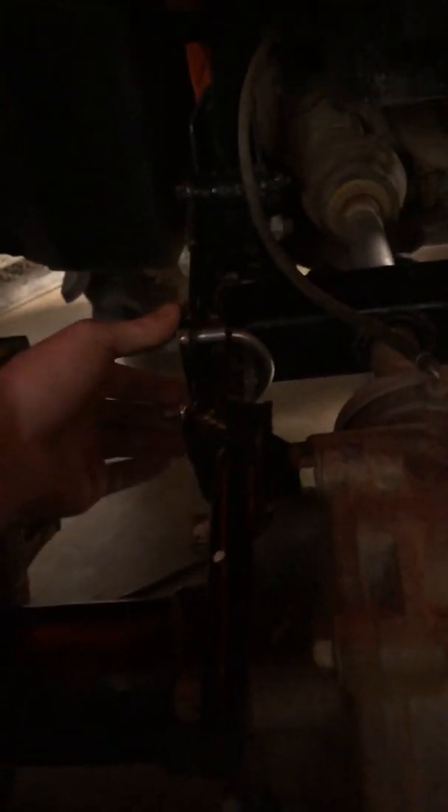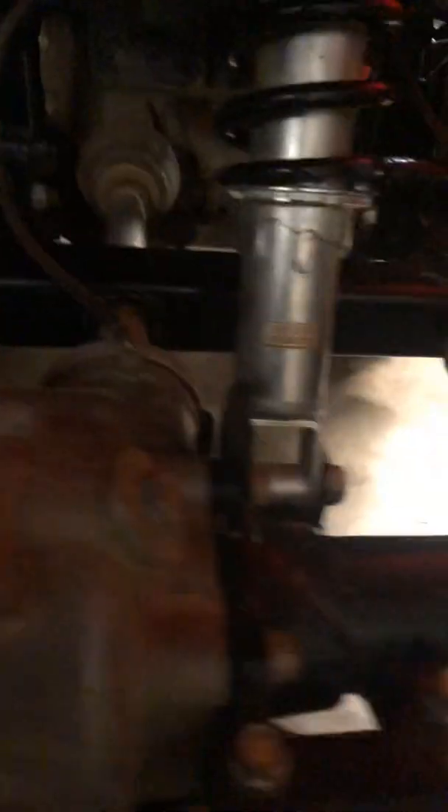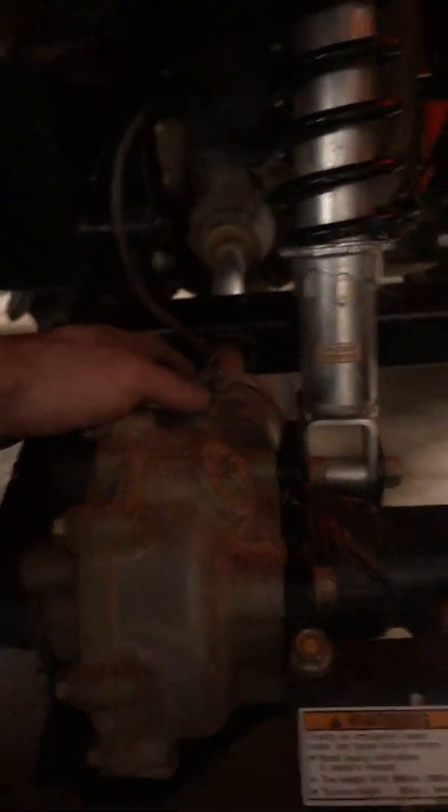You can see my swing arm stretch right there — I stretched it out, that was from Don Oglesby, stretched out with two U-bolts. One bolt going through the frame right there and the bolt holding it going through the frame up top. That stretched it back. It came with the extended drive shaft. Two-inch lift right here for the rear. Easy to put on — the hardest part was actually getting the diff out so I could put this in, and putting it back in because it didn't want to line up.